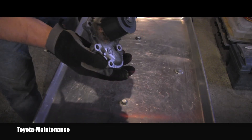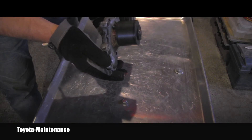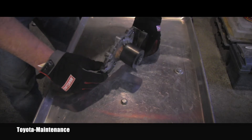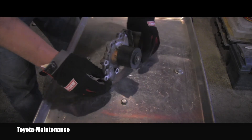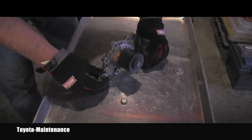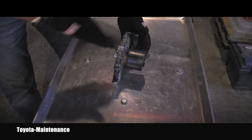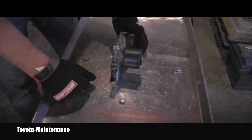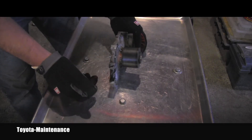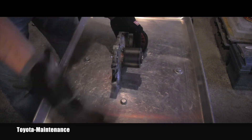This one is already plugged by a very slow leak of the coolant. There are three major failures of the water pump. The first symptom is leaking coolant — that means the seal around the shaft is failing and it starts leaking, either very slowly seeping through the weep hole like you see here, or it really leaks a lot.